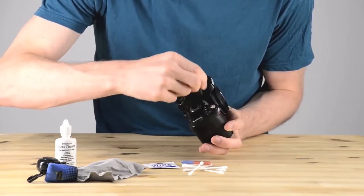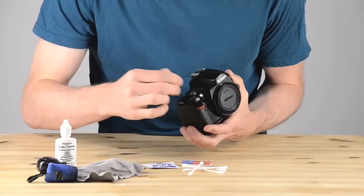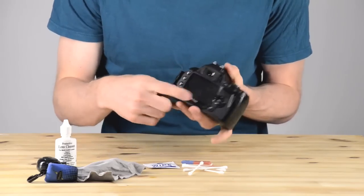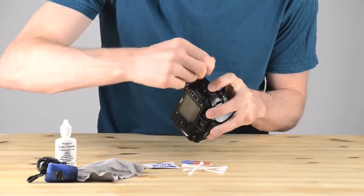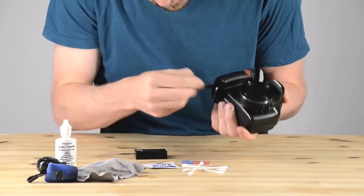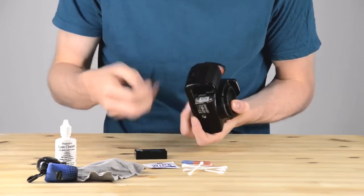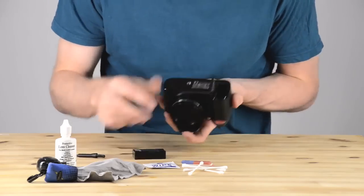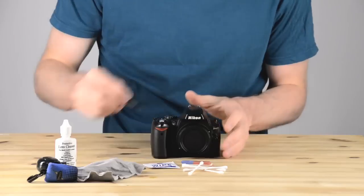That spot where I'm brushing right now with the hard bristle brush is a spot that a lot of cameras get a lot of stuck-on dirt in. I'm going towards the strap holders — there are two little holders on each side of the camera and those get really dirty too. I also opened the connections door at the end, removed the little rubber gummy cover, and cleaned underneath it. Moving to the bottom, I take a look inside the battery compartment, make sure the connections aren't corroded or covered in green goop, and check the battery itself. The battery compartment had a lot of dust around the inside, so I wiped that out with the little black body brush.